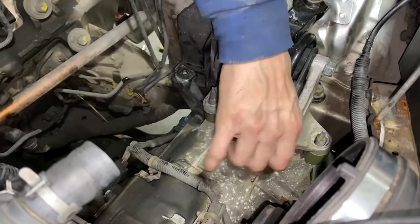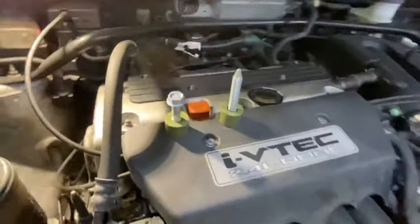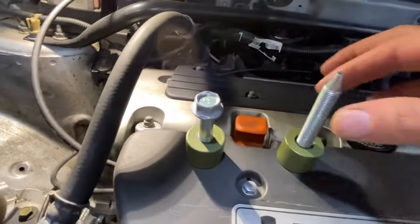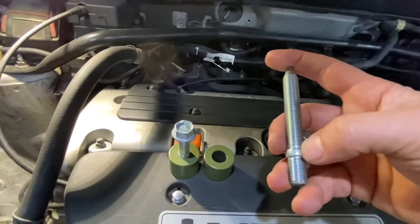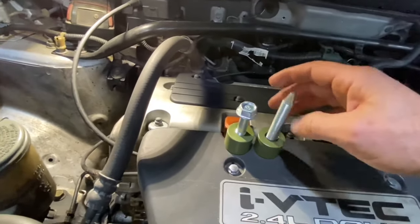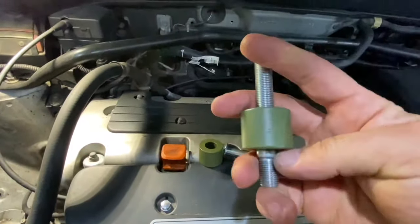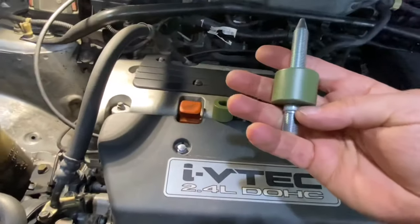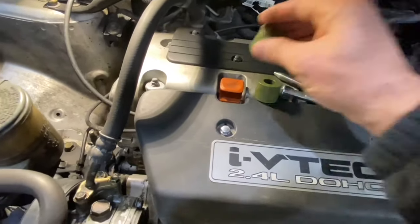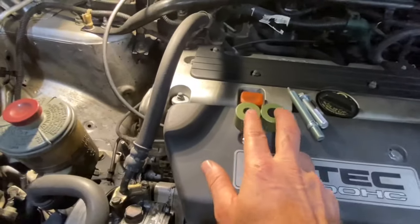This side requires two different size spacers. We've got the bolt which uses the 12-millimeter spacer, and then the stud which uses a larger one. You can see one is larger than the other — the reason is because of a little shoulder right here at the bottom of the stud. If you use the wrong size spacer on that stud it won't go down all the way. That little gap creates a space with no way to spread the load of the engine moving around, and it just puts all the shear force right on that and it breaks it off. So you have to use the larger spacer so that it slides down, everything clamps together nice and tight and spreads the load.